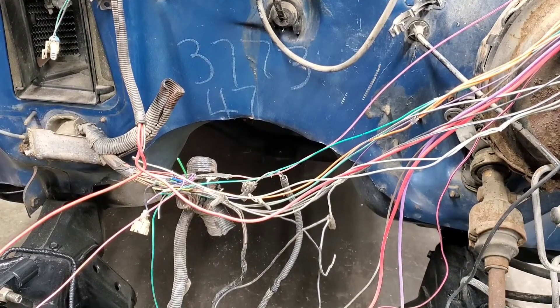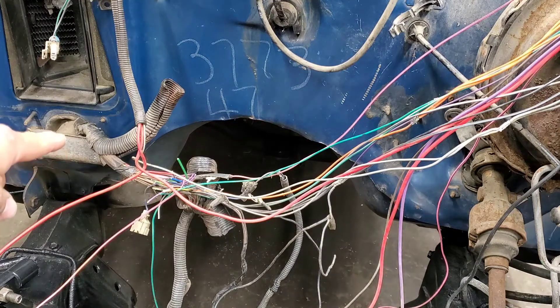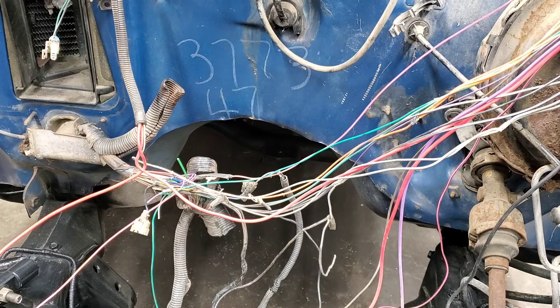The wiring here is all factory. It was a 4.3 V6 in this truck when I purchased it. I started clipping off some wires — the ones I cut went to the fuse box and also route into the computer. We're going to show you which ones you need and which ones you don't need if you're going to be running a carbureted HEI distributor small block Chevy. Hopefully this will help people speed up their research. I spent a good bit of time reading about this the past week and figured I'd make a video. If I cut something wrong, someone please let me know in the comments.